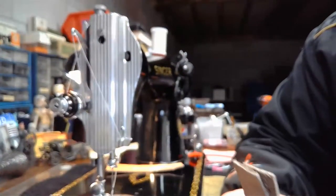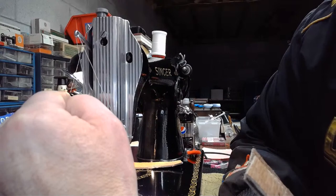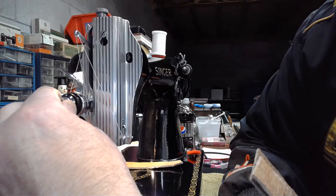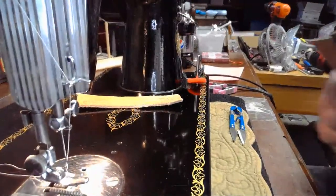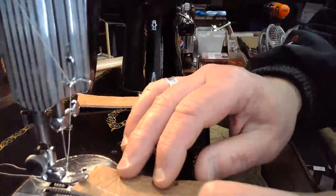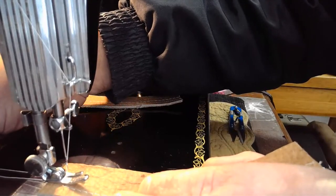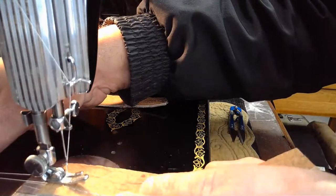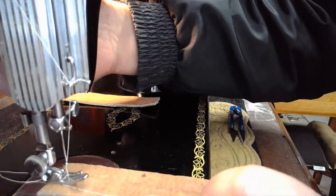So we'll stitch this one more time. I'm going to go ahead right now. We're at about four. I'm going to take us up to about five. And we're going to stitch this one more time and just see what impact we can bring. Again, when you're making tension adjustments, especially sewing at this level, you've got to be mindful that if you're trying to define that lock stitch more, you just don't want to go too far with the adjustment, because what can happen then is it can start to take away the beauty and the definition of the top stitch.